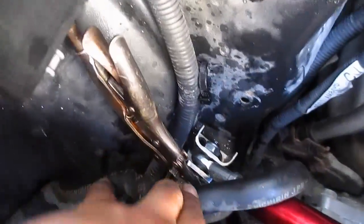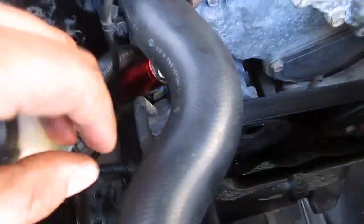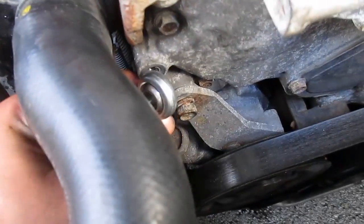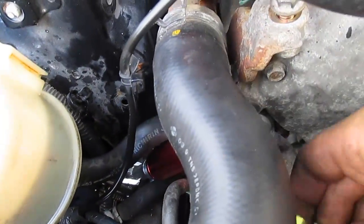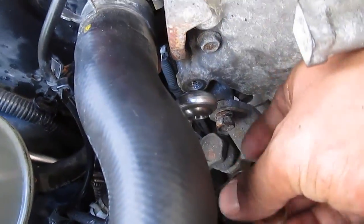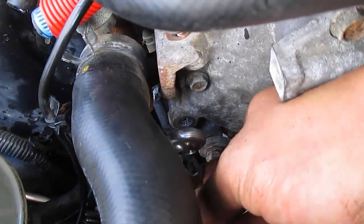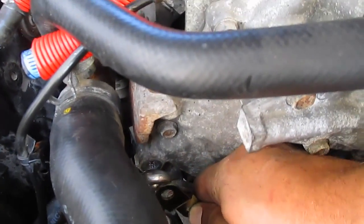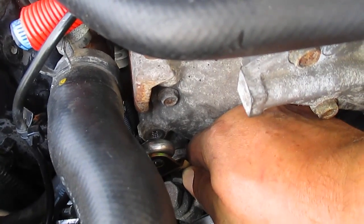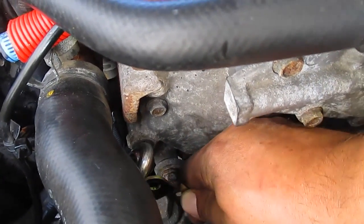Okay, so I got that bolt in. As you can see, I had to use a set of vice grips, so that was like the most ignorant bolt to get in so far. Now comes the critical part where you need to adjust the length in order to get this bracket proper. The way that it's going to work is you're going to take out that bottom bolt, and this bracket is basically going to go inside. Let me see if I can hold the camera like that. Okay, take 2: basically just going to hold this in that bolt and sandwich that up against here in order to make it solid.